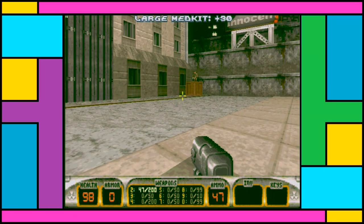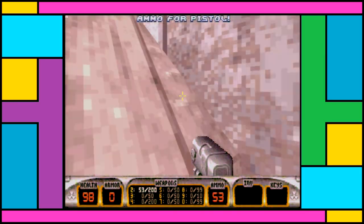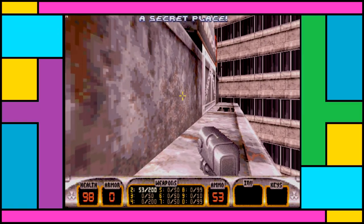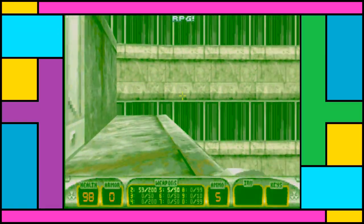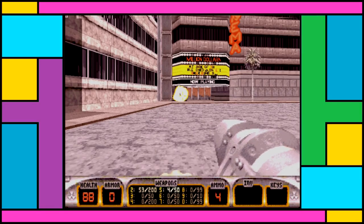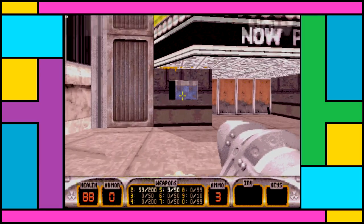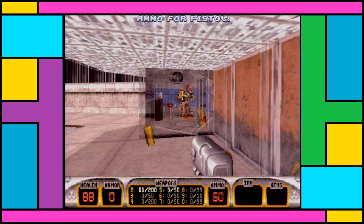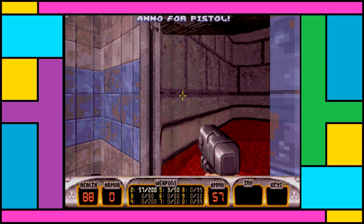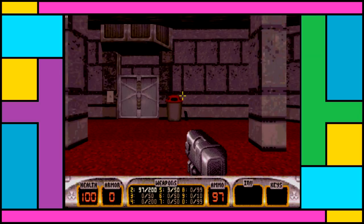The card really is about the only reason I have Windows 3.1 on this machine, as I did want 95 on here, but the card just wouldn't work there. Even then, the Gus driver has phantom issues, and it likes setting its parameters to those that the card isn't using, which is another issue, as it's surprisingly hard to find a comprehensive list of jumper settings for this version of the card. You don't even get a proper mixer or anything in Windows, absolute japes.